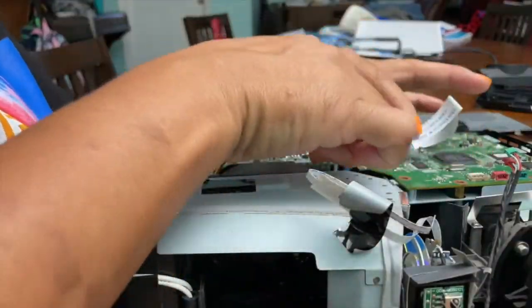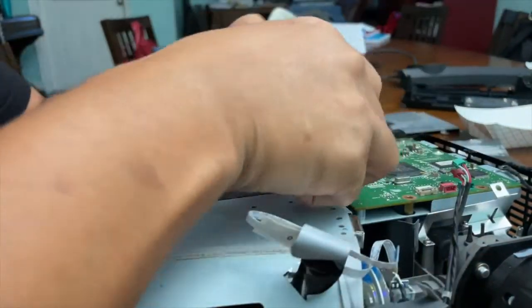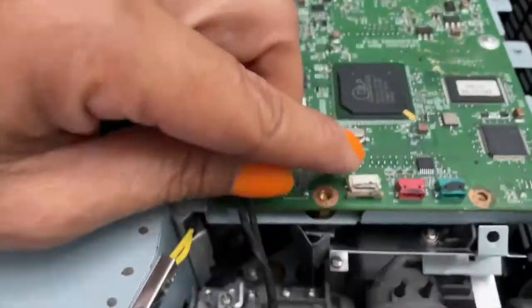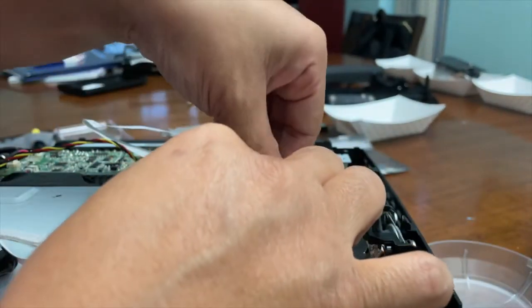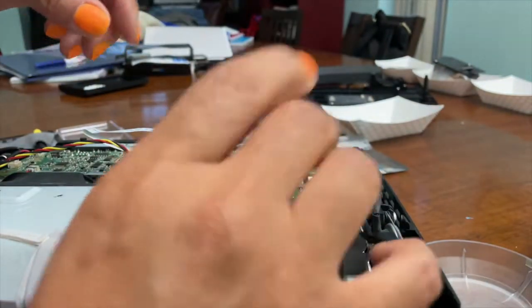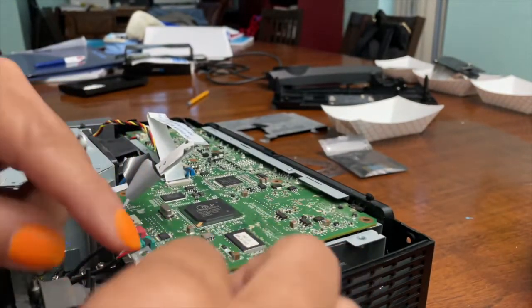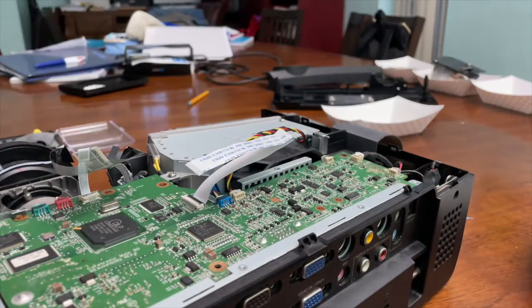Those three are repositioned. We're going to connect these two, the yellow, red, black cable, and then the blue cable. And then we have these three, 1, 2, 3, the white, red, and green. The white is a ribbon, so we'll start with the red and green. Slides right back in, a little bit of force, it'll click back into place. The ribbon is loose, make sure the tab is loose, slide it underneath. Once it's in position, then you tighten that little tab right over it and it holds the ribbon in place. This cable here that's loose will be attached once we put the top plate on.